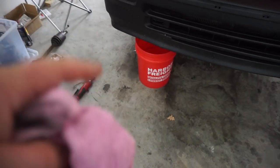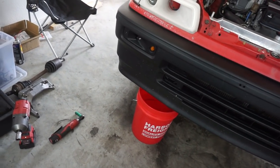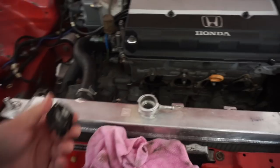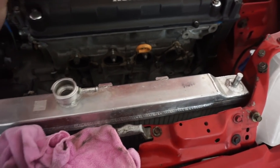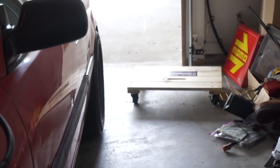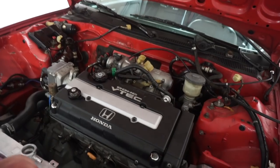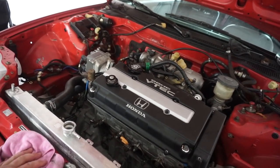We're back and we are draining the coolant into a bucket. Just gonna chill out, let that do its thing. We would always pull the cap off, help it breathe, let it flow a little better. Flowing now. Then if you notice, I just got another dolly. Put that dolly underneath the car, lower it down like we did the DA, undo the side mounts, and then lift the car back up, pull it out.